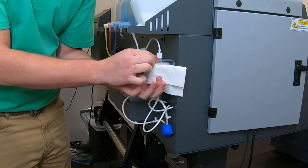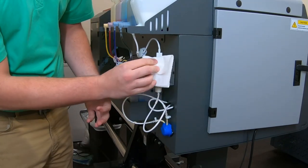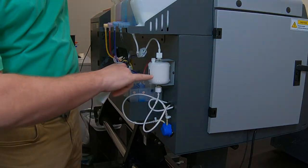This can be easily wiped off. After this release, reattach the air cap. Line burping need only be done when you see the white ink level appears low, or as you may notice white ink dropping in your print jobs.